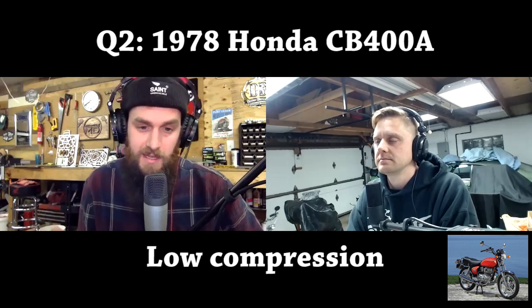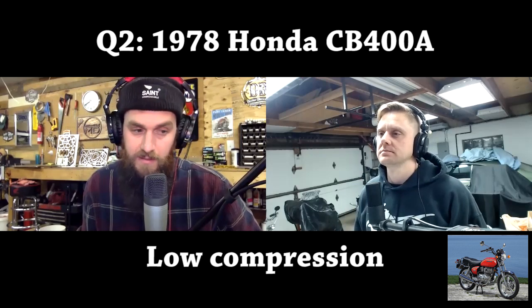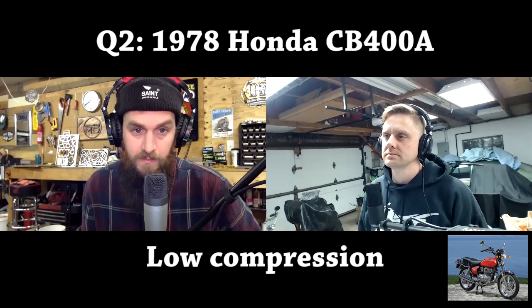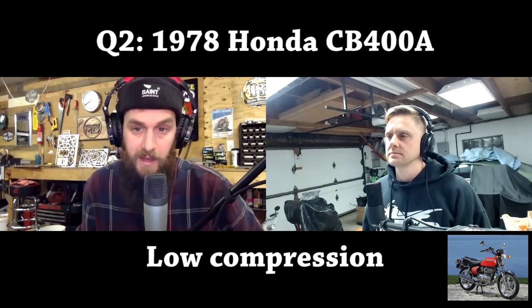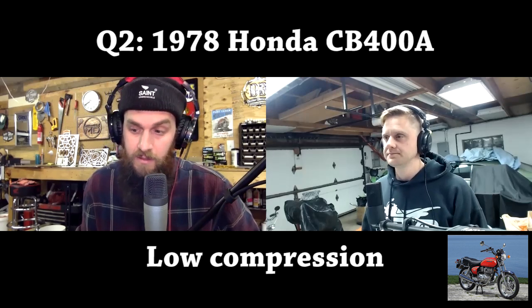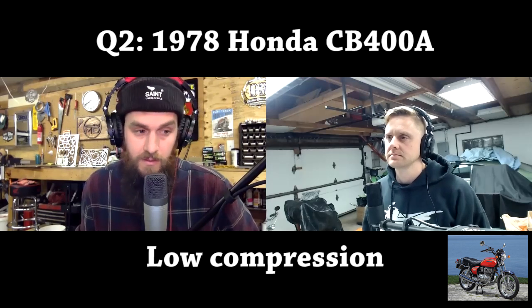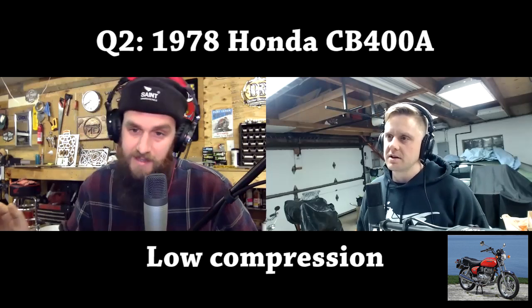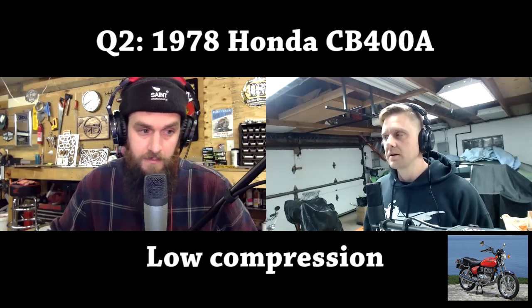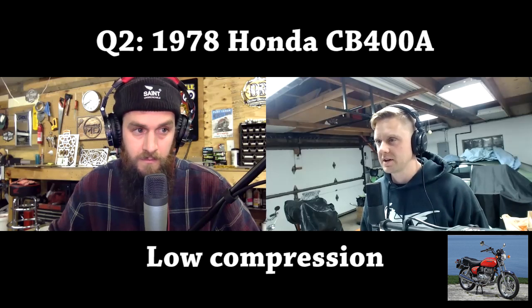And what this guy's going through, it sounds like he's got low compression. He's trying to solve an issue that is avoiding the real issue, which is he likely has either a worn cylinder and piston or a wiped cylinder and piston. He needs to do a leak down test. Matt, you got some videos on that? Yep, I do. Leak down the cylinders. Running at 100 PSI, it's not going to do it. So this thing should have what? 150, 170? Easily. Now, those motors before you rebuilt them, did you take compression tests?